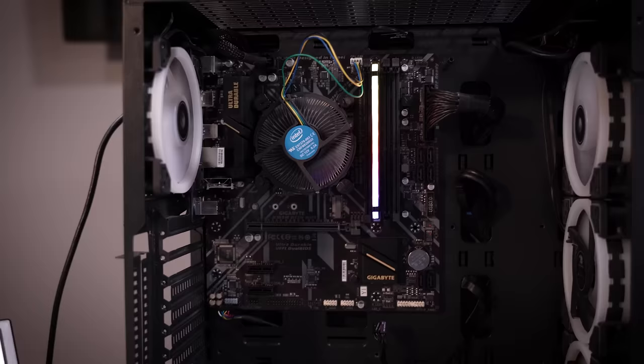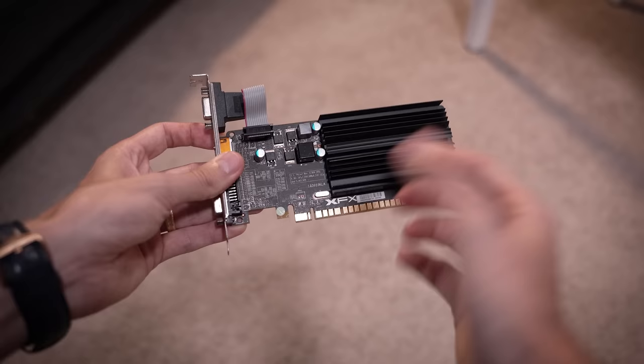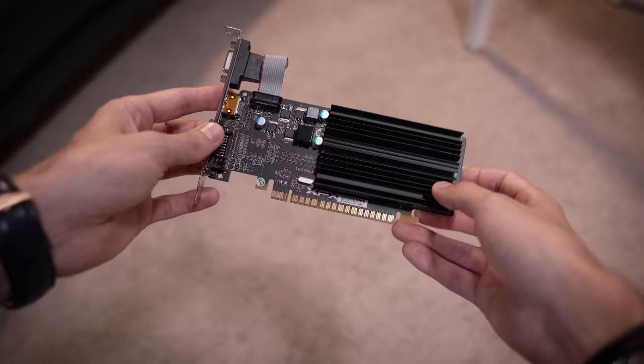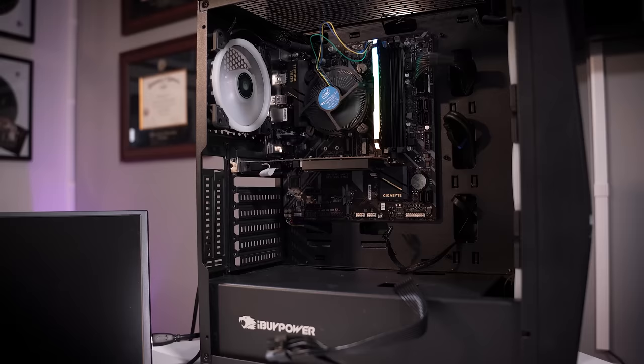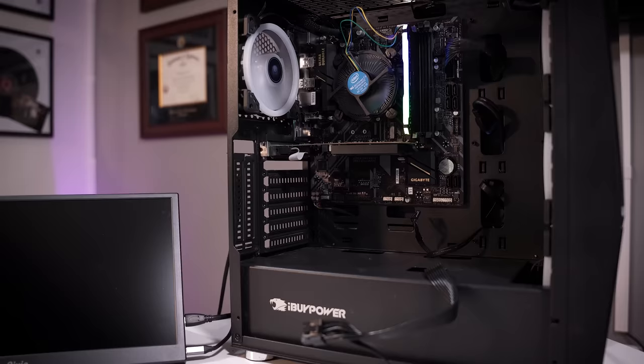Let's get the trusty placeholder card — it's an XFX card, so they only make AMD stuff, meaning it's some sort of Radeon, but it's still nice to have as a placeholder when troubleshooting. Swapping this out for a beefy card just makes more sense, and it's also nice that this doesn't need supplemental PCI power, so installation is faster and cleaner. However, upon booting we still do not have a picture. I think we're going to have to move on to the platform itself — at this point I'd be willing to bet there's something wrong with the socket or just the motherboard in general.